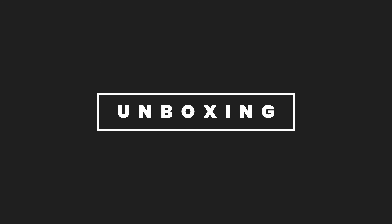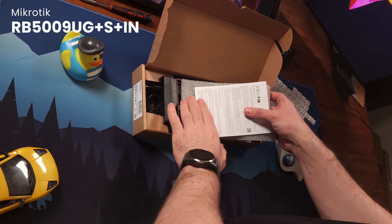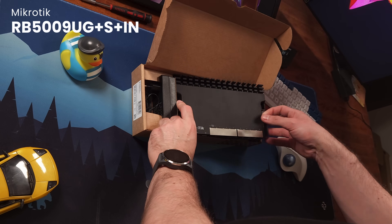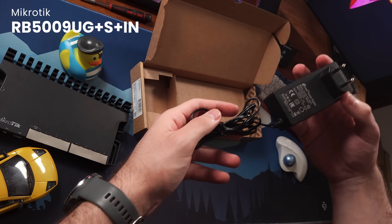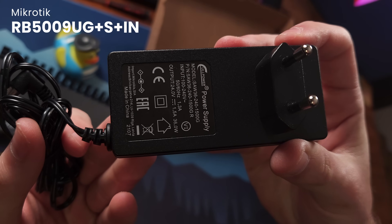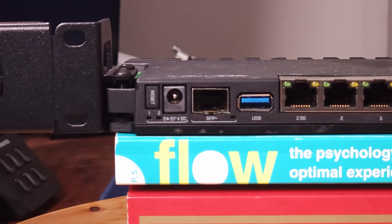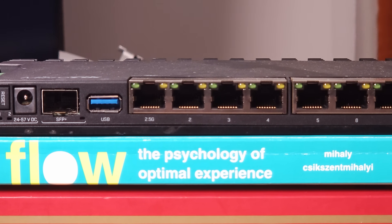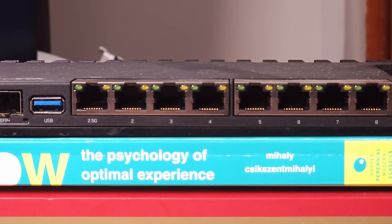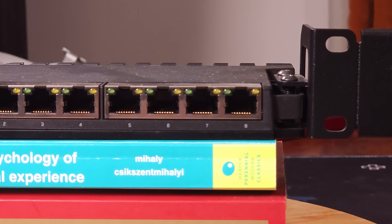Let's take a look at what we are upgrading to. Inside this box we have the MikroTik RB5009UG+S+IN, which is a low power and completely passively cooled RouterOS device from MikroTik with quite an interesting assortment of ports. It's rocking one, two-and-a-half, and 10 gigabit network ports. Starting from the front side of the router we have a DC power input, a 10 gigabit SFP+ port, a USB 3.0 Type-A port, a 2.5 gigabit RJ45 port which supports PoE input as a second means to power the device, and finally seven more 1 gigabit Ethernet RJ45 ports.